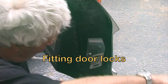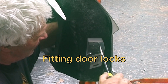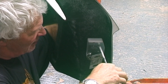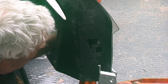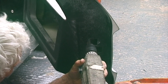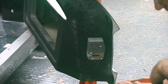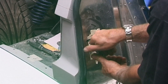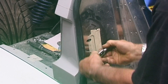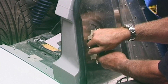Fitting the door lock switch — if they're in the right position it's fairly straightforward, but if they're not, it's extremely difficult. Also tapping some holes to fasten it on. I hate tapping M6 holes.